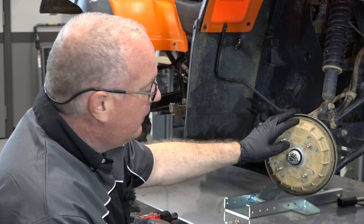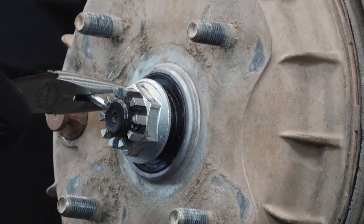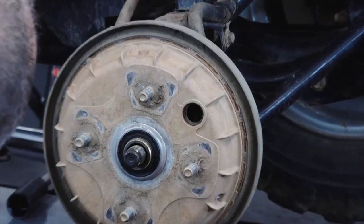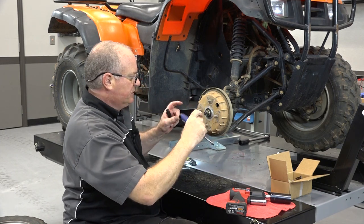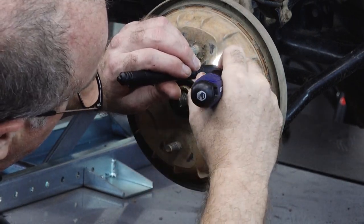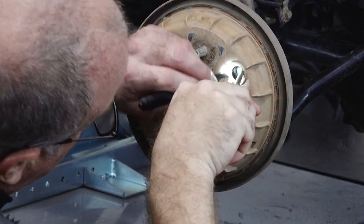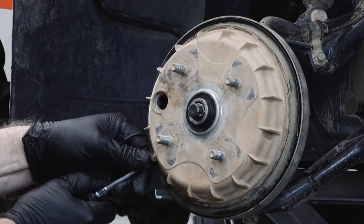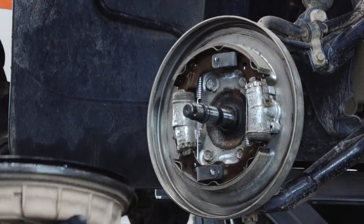Alright, so we've got it lifted up in the air and we've got the front tire off. The first thing we need to do is get this cotter pin out, try to get it as straight as possible, then take off this castle nut, and then the brake drum assembly can come off. I've pulled this little plug here, and what that does — if you've got the hub in the right area — is expose the piston that's in there. There's actually two of them. We're going to ratchet those back to their closed position, and that should give us enough room to pull the drum off. And there she is off, which exposes all the working pieces on the inside.